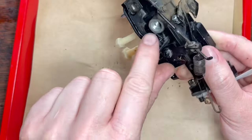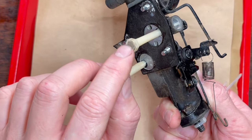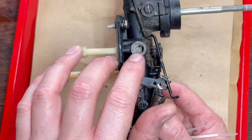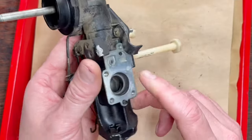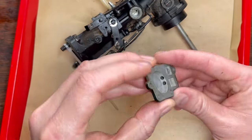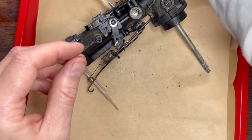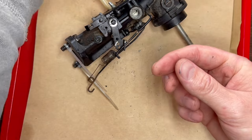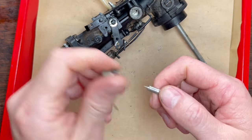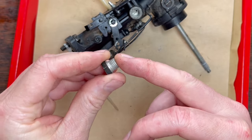We need to clean the second tube and that way we can, if possible, squirt some fluid into that hole. But better yet is just to go and spray through that mesh and clean that off there. We then have two extra holes inside — we're going to clean those two out as well. And then of course we'll just go over the rest of the carburetor and make sure it's nice and clean before reassembly. We have the cover plate which has two big holes — they don't tend to get blocked but we're going to clean those as well. Then we have the main jet which needs to be cleaned. And then we just need to double check that that needle again is nice and clean, not deformed, and the threads aren't damaged as well. And the same — the threads aren't damaged on there.